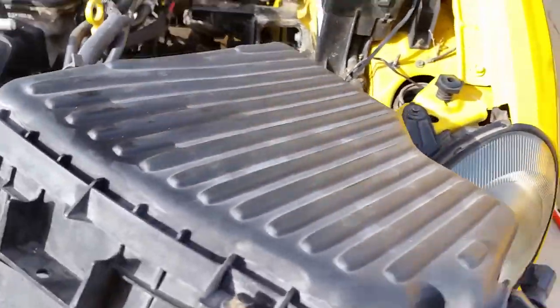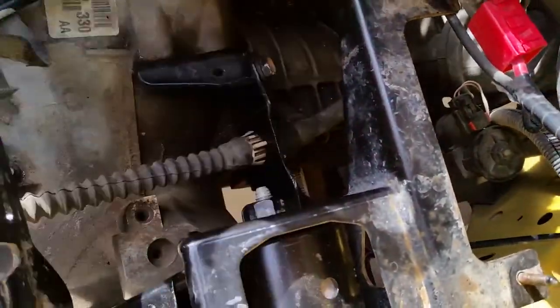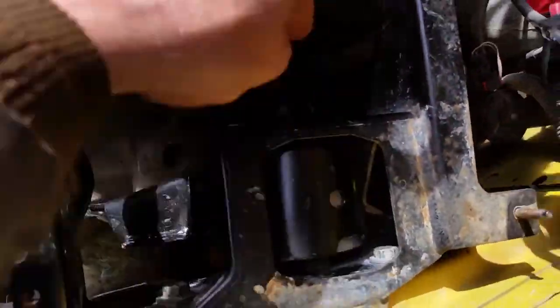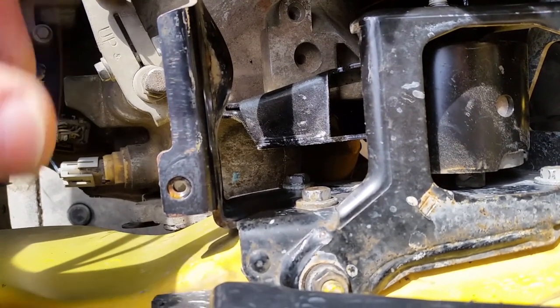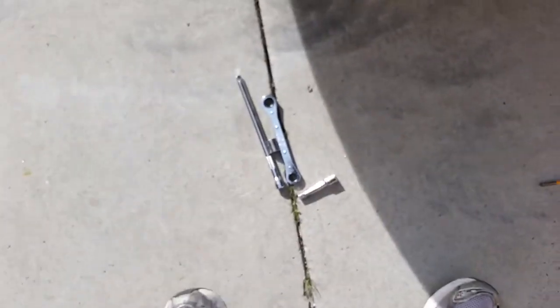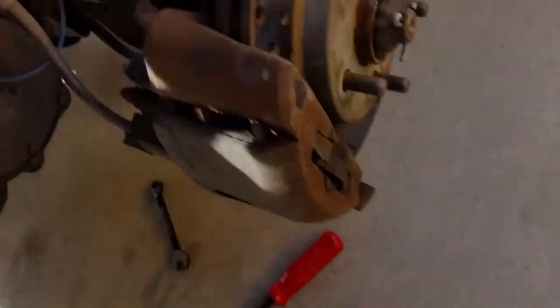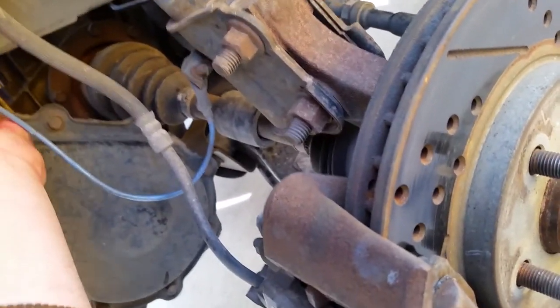Good morning — well, it's the next day. Got the engine mount in, everything pulled back up and tightened down, got the mounting bolt in. Took a little bit of time — this one down here is all by box wrench. Couldn't get a ratchet on there until it got down quite a bit, then I got a ratcheting wrench on there. Bolt's in, getting ready to finish putting it up. I think she's ready to go. Put this grounding strap back on there — grounding strap back in. Everything looks good, tight, connected back in.